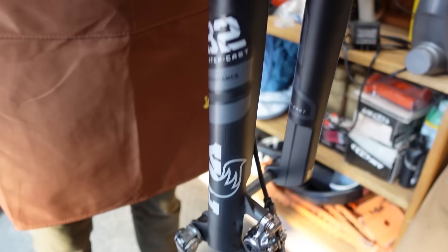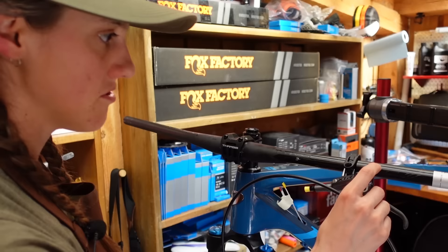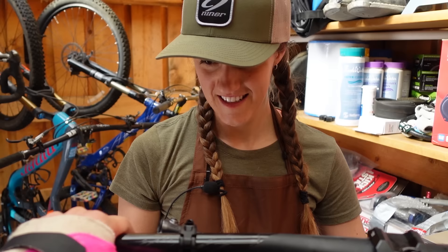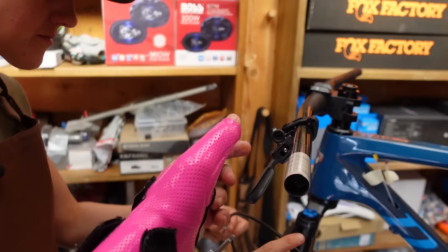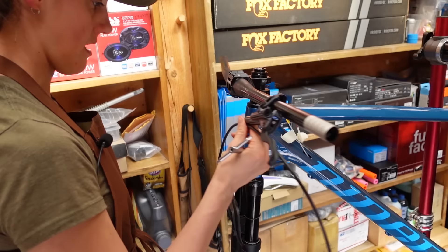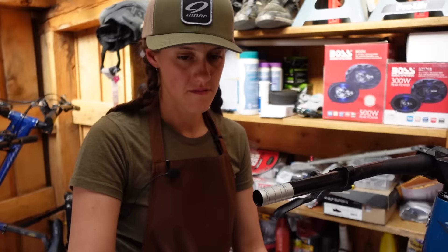First thing is make sure that you're running up the inside of the fork, and that you're accounting for the fact that it's going to be attached there. Do you care about putting the grips on or are you okay with just estimating it? I can approximate — my hand will be here, out a little bit, in a little bit. You want to tighten the lever in its approximate place, hold the housing to where it will approximately be, and then turn the bars. Step one: figure out your length. Step two: remove the squiggly wiggly thing on the end.